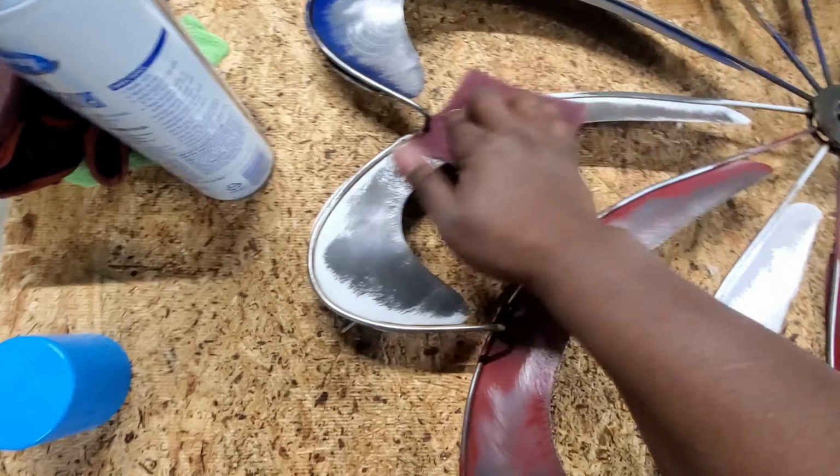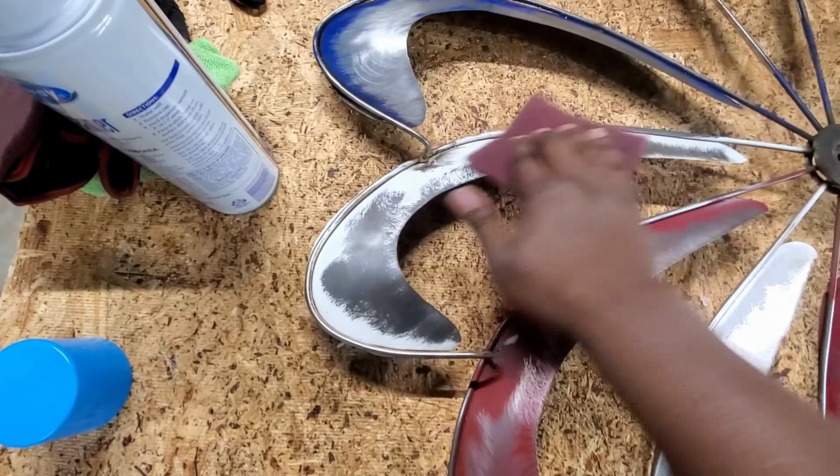And we're epoxying because it's bare metal showing. So you want to protect that bare metal with epoxy primer, and then we'll 2K high build. Sounds like a lot, but it can be done.